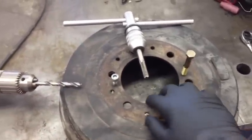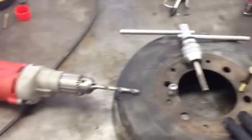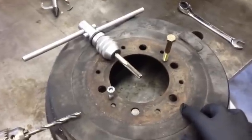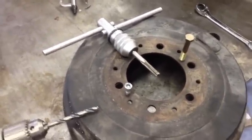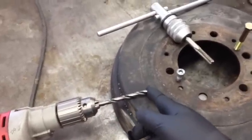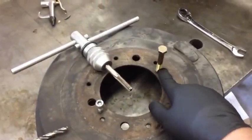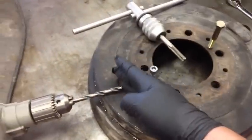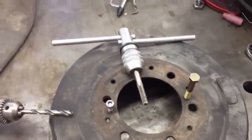But it's so close to that rear axle flange that I didn't want to drill into it. So I took a 5/16 drill bit, which is for 3/8-16 coarse thread — I wanted to do fine thread but I only had one Q drill bit and didn't want to ruin it. I had to sand the tip off so that it would only use the sides to cut, because it only had to take a little bit off to open it up enough to tap it. I sanded the tip down so I could just get a few threads started.